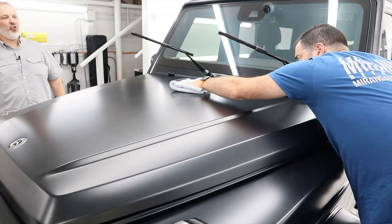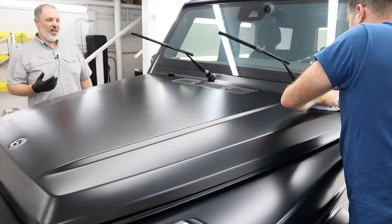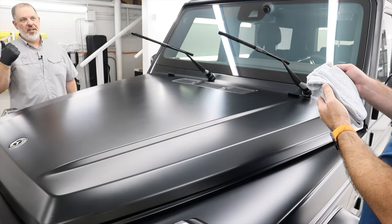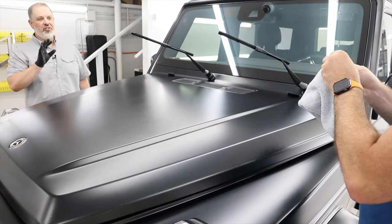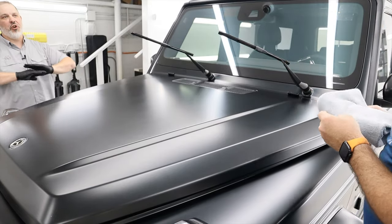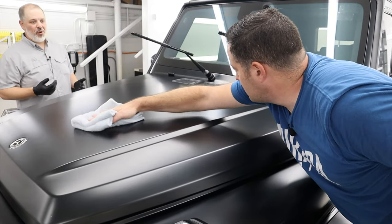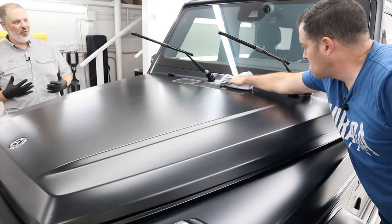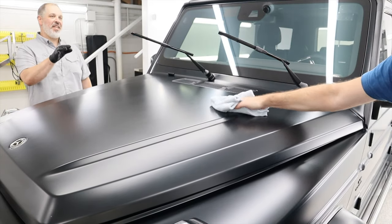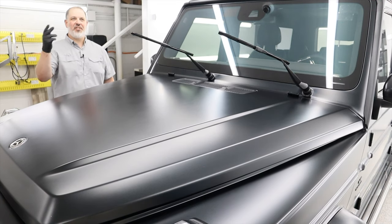For curing: we want one hour undisturbed, 24 hours dry, and two weeks hands-off — no washing, no quick detailers, nothing. After the cure, if you'd like a little more slickness on your matte finished vehicle protected by Matte Paint Coating Pro, use Matte Bead Hero as your topper or maintenance product to get some of that slickness, though you'll never get the slickness of gloss because the surface is textured, not smooth.